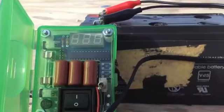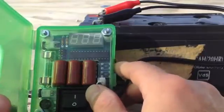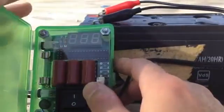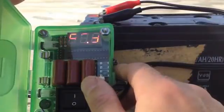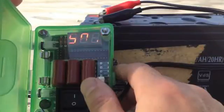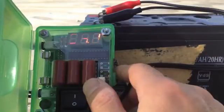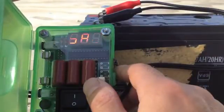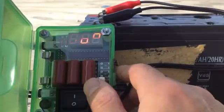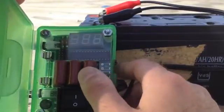I've been letting the pimp battery charger work on this battery for about one minute. I had the voltage display off the whole time, but I'm going to turn it on now. We're seeing in the 45 to 60 volt range — it's jumping all over the place as it's pulsing and recovering. What I'm going to do is let it run for about 10 to 15 more minutes and see where we start to stabilize. I'm curious whether this battery is going to be able to recover, and we can find out very quickly if it's going to have a full recovery. I'll turn off the display, let it keep charging, and come back.